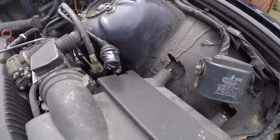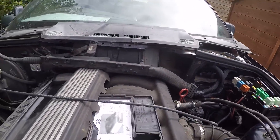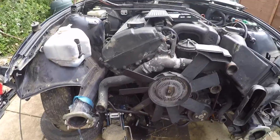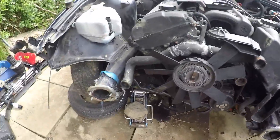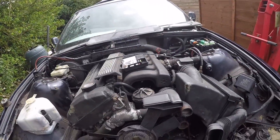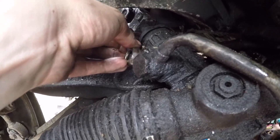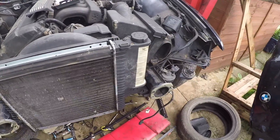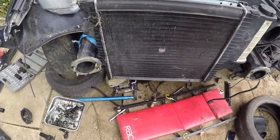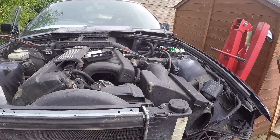Put the intake back on — remember all your cables — and then you've got a lot of screws to tidy up. The big stuff is like power steering lines, so I'll move on to those. Radiator, which is pretty much it. Depending on your engine or whatever, you might have to slightly bend the lines to meet your steering rack, but it's not hard — just with some vice grips. I've read that you need six-cylinder radiator mounts, but I've kept my four-cylinder ones in and they seem fine. It looks right where it sits, but we'll have to see.